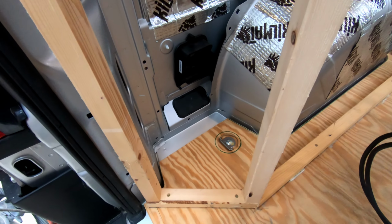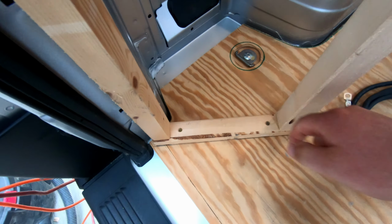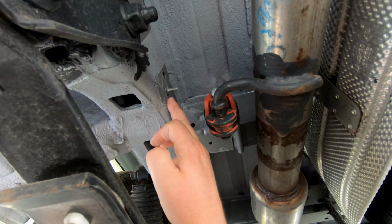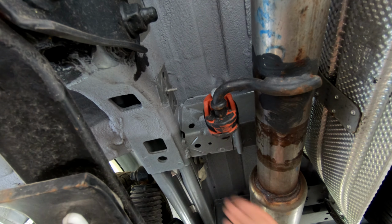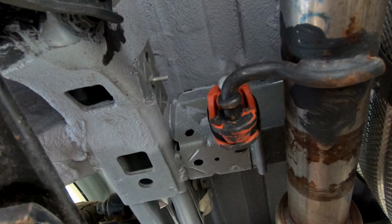So one convenient thing I just found is a grounding lug on the van. So I'm going to drill through right under here and follow me under the van here. Okay guys, so right here, conveniently located on the left wheel well, is a ground lug. So this is the main chassis line. This is a unibody build, but this is still considered like the main chassis. Good enough to ground this unit back to the starter negative terminal. This is going to be considered our chassis ground for the entire system.